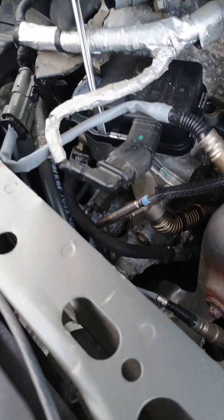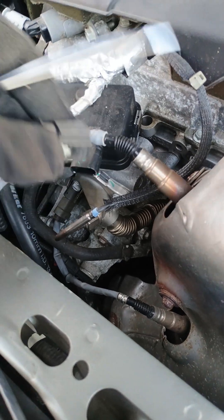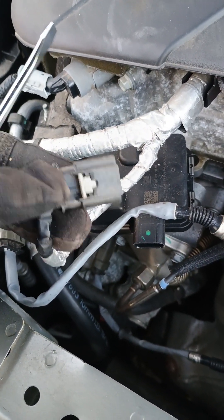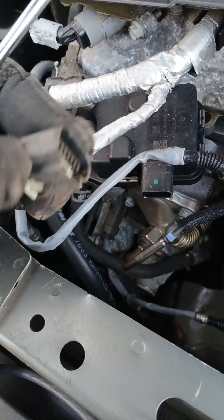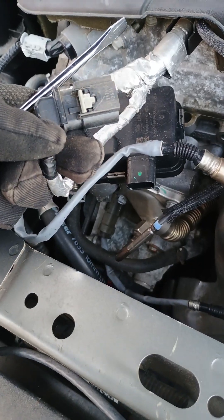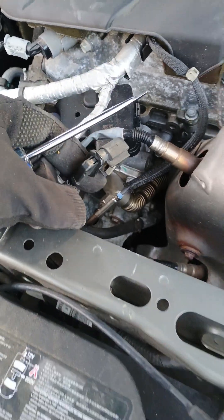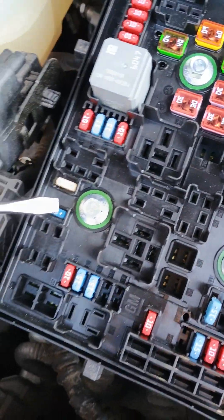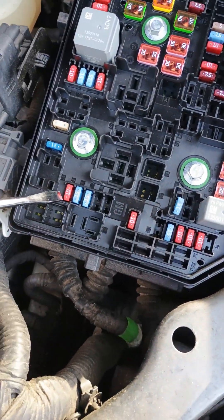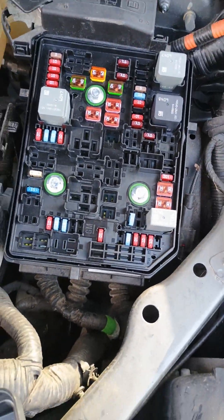If it's nice and warm outside, you're supposed to pull the gray tab back, but you can force it off too — I had to force it off earlier. Once you unplug the EGR valve, leave it unplugged. Then come back over here and swap out the F3 fuse with the emissions fuse, unless you already have a spare somewhere.